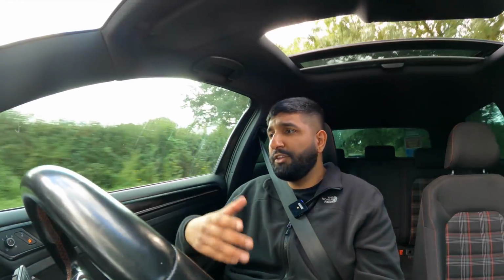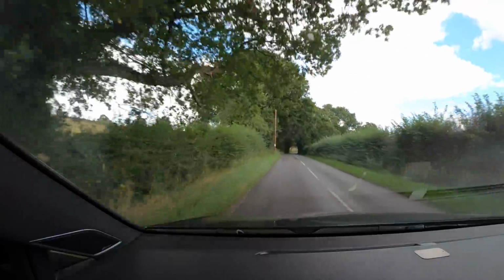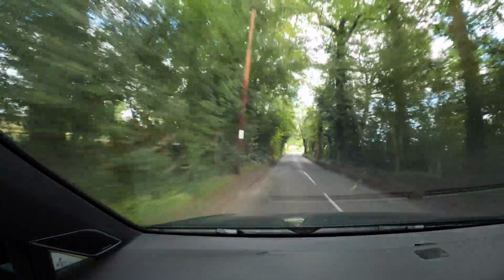Lovely feel. The only area where the car was sort of hampered, let's say, is it letting off a huge plume of smoke after 5 laps of abuse. And I'm pretty convinced it's not the clutch. I've been thinking it's the clutch the whole time, but I think it's the PCV, and that's the reason why a lot of you folks do run a catch can.